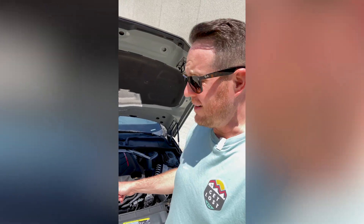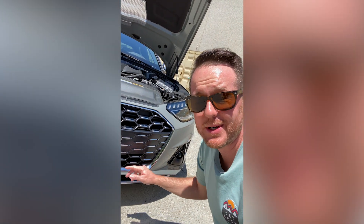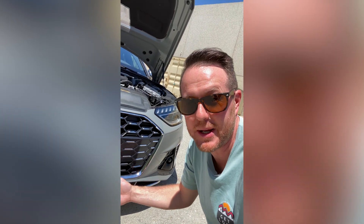A stock A4 is only pulling like 260 horsepower max. But for me right now, after stage one tune, cold air intake, and turbo inlet, I should be sitting at around 400 horsepower. So this A4 intercooler is not going to cut it, especially not for my upcoming Laguna Seca trip. I'm going to need to keep things cool lap after lap to avoid heat soak, which is basically diminishing power output over time.